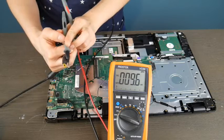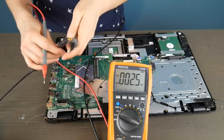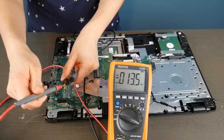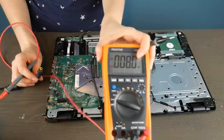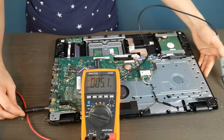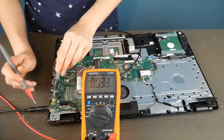The first thing I'm going to do is put the black lead on the outside of the charger, because I want to test my charger first — a process of elimination. I want to make sure the charger is giving me the right amount of power. As you can see, I have a readout of around 18.9 volts. I'll double check that with the power cord itself. Looking at the brick in the back, it says 19 volts, which is well in the range of normal — so 18.9 is acceptable.